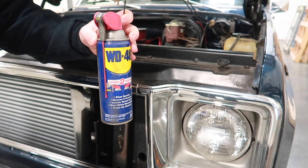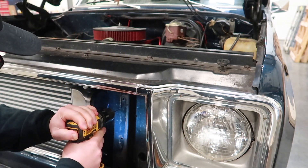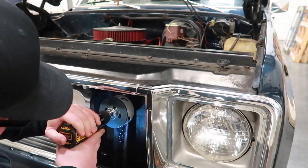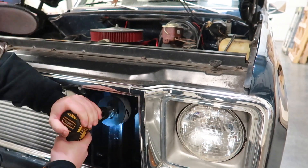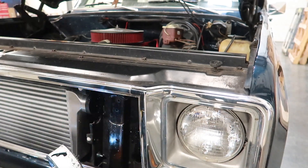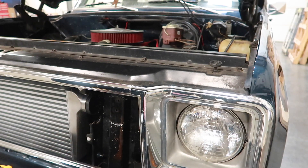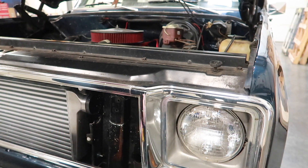I'm going to use a little bit of cutting fluid — a little WD-40 — to keep the tool cool. Now the issue I'm running into is the hole saw isn't deep enough to go the whole way through, so I'm going to have to cut this out with the grinder and then keep punching the hole through.